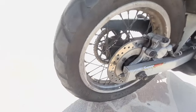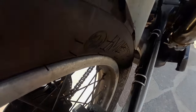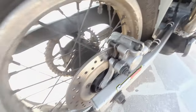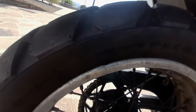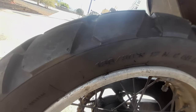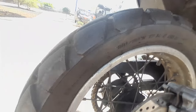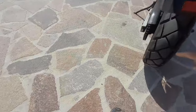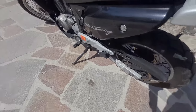Looking at the rear tire — I've got a 130 on here, and you could probably fit a 140. The recommendation is 130/80 R17, but the standard spec is 120/80 R17. I could quite happily fit a 140 in there, which I might do when I change these. It handles well — you can crank it right over with the bars, no problem at all.